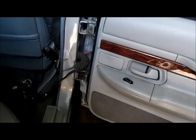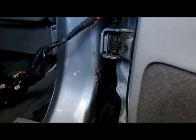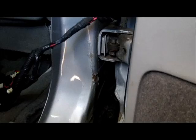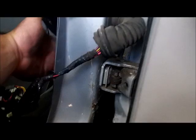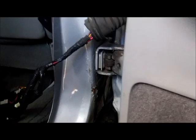So I'm not sure yet — probably do what I've been doing. Got no real way to pull this, unfortunately. Don't have a frame machine or anything like that here. One of you guys questioned a stud welder — a stud welder really isn't going to pull that; it's pretty stout stuff, it's just going to rip the studs. So I'm just going to have to figure out how to get this out. I could put the old hinge on it, go outside and get a come-along tied to the back of my truck, get a lot of pressure pulling outwards on it, and then beat on this with blocks and a sledgehammer. That might end up being what we have to do, but I'm going to try to avoid that if possible.